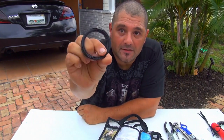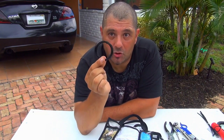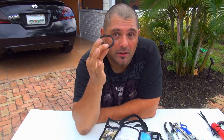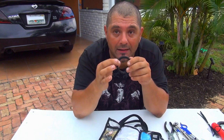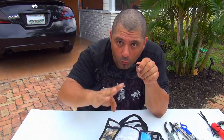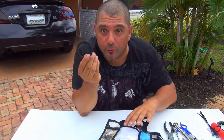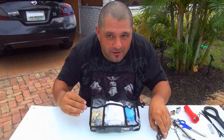This is a little steel wire you can find at the dollar store for a dollar. It's for harder situations — if your exhaust clamp breaks, you can tie your exhaust to the swing arm of the scooter. Remember, tie it to the swing arm, not to the frame, because the exhaust moves with the swing arm. This can get you to the nearest gas station or home. Put about 10 feet of wire in the bag.